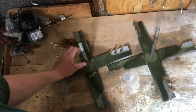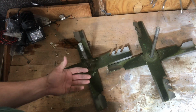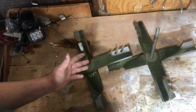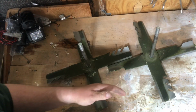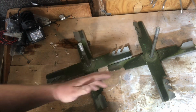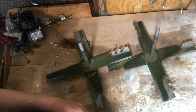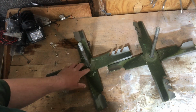The other thing that's pretty interesting about running XBLADES is, at least on my mower, I'm running a 36 Bradley walk-behind hydro mower, this makes it so the clippings shoot a lot further out the side of the mower. If I have just one blade on, it will shoot out maybe a pass and a half. If I have XBLADES on, it's shooting 3.5 passes. So you're getting a much greater dispersal of the clippings with this.